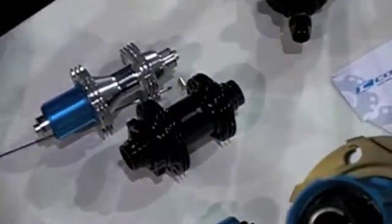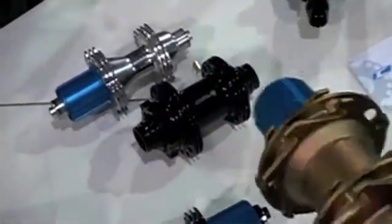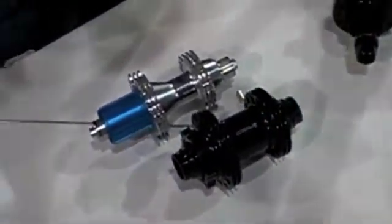That one uses what we call fathead spokes. I don't have one of those here to show, but it's got a butting on it about that long, and it's got a bigger head on it, and the butting is actually a 2.3mm diameter. Okay. So it's a really fat spoke at the end. And what it does is you sort of hook it in like this and it folds over, but it still allows a little bit of movement so that when we're building it, we get our straight pull again. Okay.